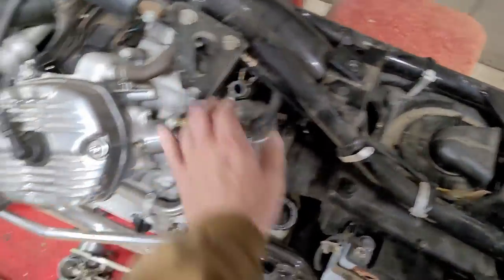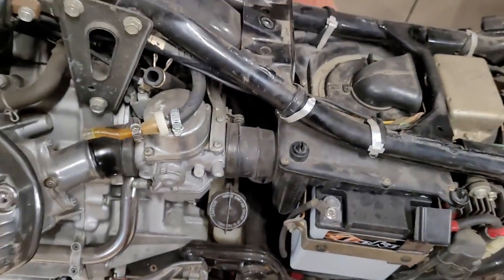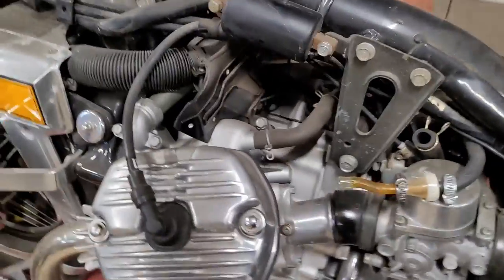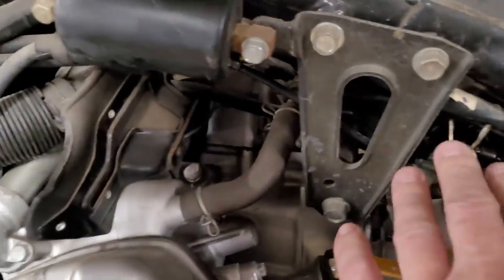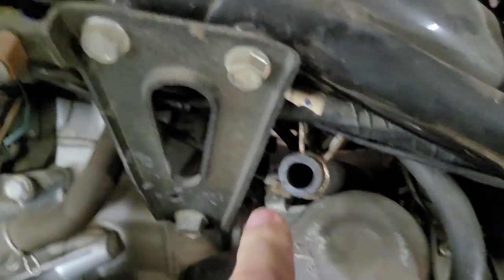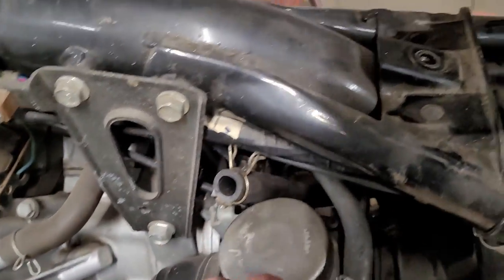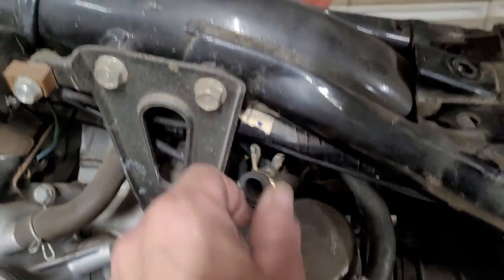So, I don't know where that goes right now. I have to see where it actually goes down to. Oh, airbox. So I wonder, huh? I wonder where that could have went to. That popped off, goes to the airbox. I wonder if there's some funky thing that might... wouldn't that suck? If that's the only thing that's wrong, is there some type of ginormous vacuum leak?